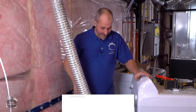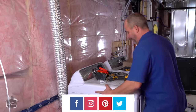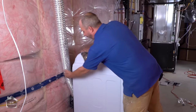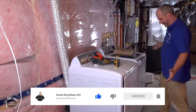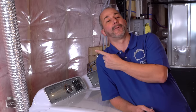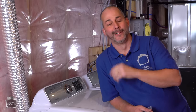Well, that was quick and simple. All we've got to do is push it back in place, take off all the protective wrapping, and push with your knee down at the bottom. You're going to have to give yourself about four or five inches of space for the ductwork. And just for aesthetics, we'll pull the machines to be flush. If you found that information helpful, hit a thumbs up. Don't forget to subscribe — we have a lot of great content coming out, and if you're interested in more appliance installation videos, hit the link to see how to install stoves, dishwashers, hood fans, and all kinds of great stuff.